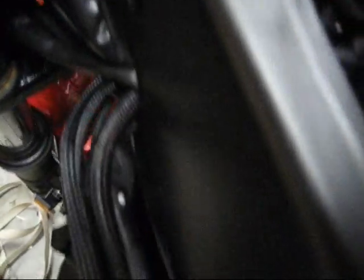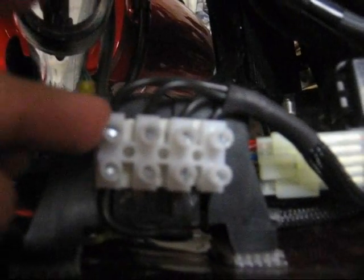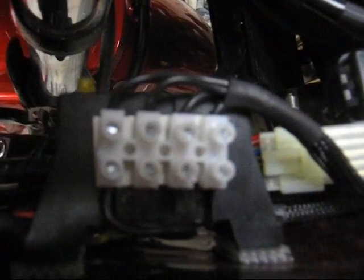From there, the wire, which you can see is black and then turns red, runs down through the frame and around to this black item, which is an AutoZone 4-position fuse box. There is also a second wire coming off of the negative terminal of the battery, which runs to this white block that has been stuck on top. This is the main ground.